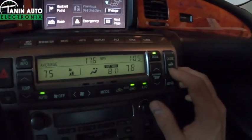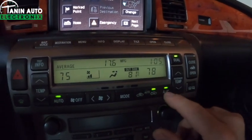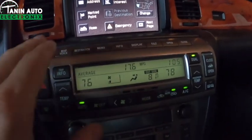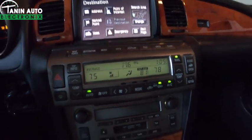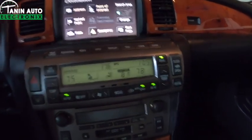If you have issues such as the top not working anymore, AC not turning on, certain buttons like let's say the left temperature doesn't work, that could all be the back circuit board problem. But you want to have this diagnosed first by a dealer or a shop, because you don't want to spend all that money just to find out you still have the same problem afterward.